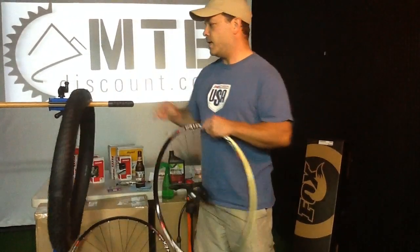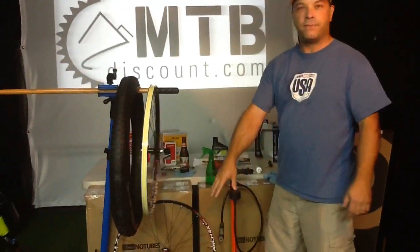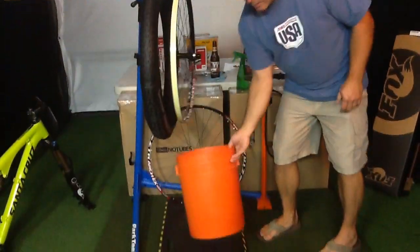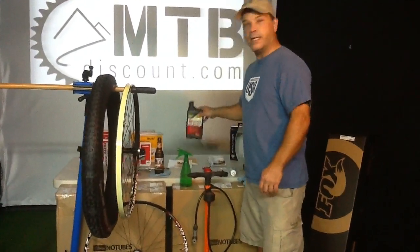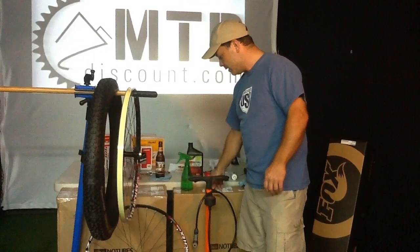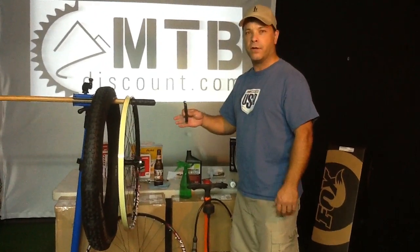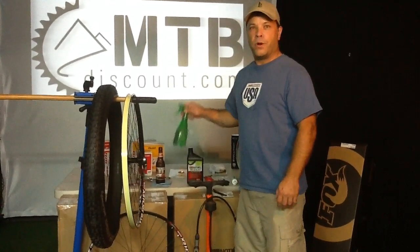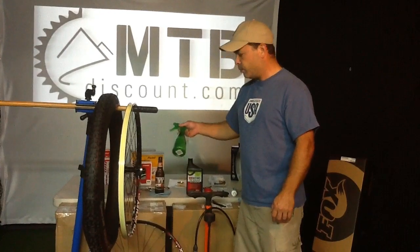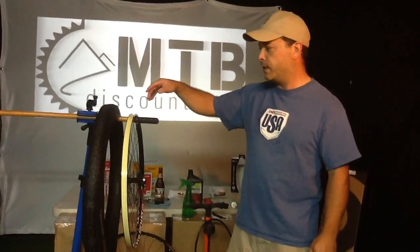For the tools you're going to need for this job, you're going to need a floor pump, of course. I use a five-gallon bucket, which makes it a little bit easier to do the mount up. You're going to need some Stan's sealant, of course, and a tire lever, maybe, just depending on the bead you're running. We're using a Kevlar bead, so it usually goes on by hand, but sometimes it needs a little encouragement. And some soapy water — just a little bit of water and some dish soap works fine, just enough to make it bead up a little easier.